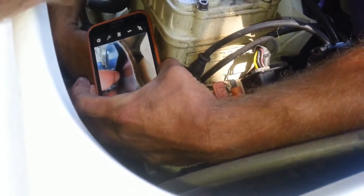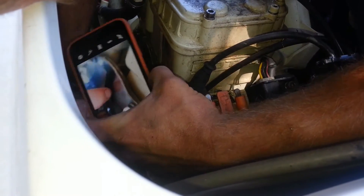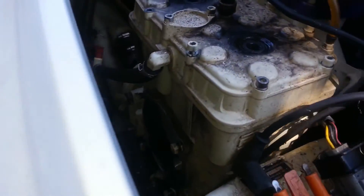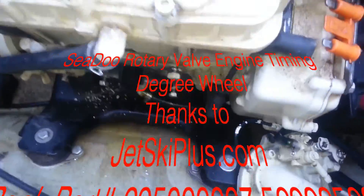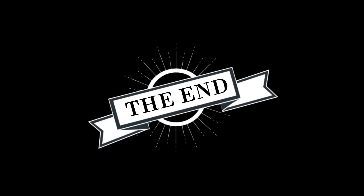Ricky is getting that installed, and as you can see, he's using his phone to get it lined up. It takes a little bit of finagling to get it on, but it should line right up with the teeth and your mark. After you get it on, you come over and make your scratch mark. You can recheck it by putting your wheel back on to make sure everything lines up. One more quick, easy way to get something done yourself and save some bucks. To be continued...